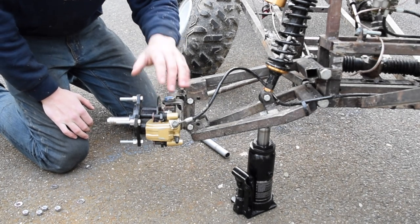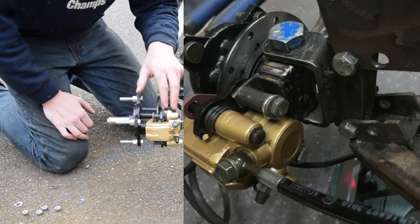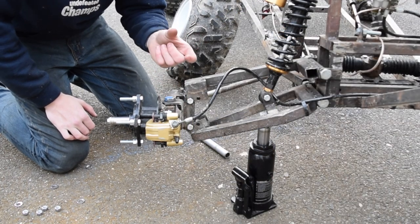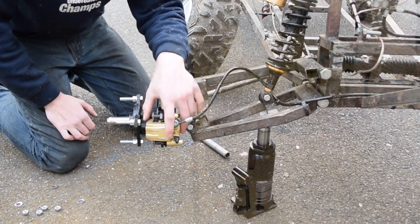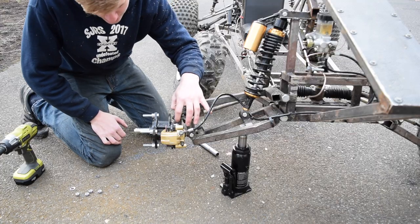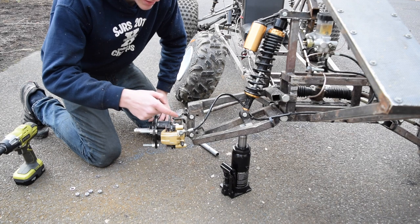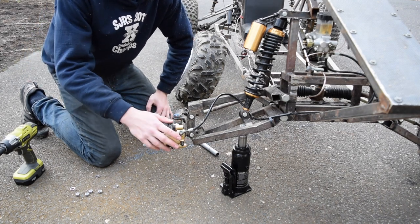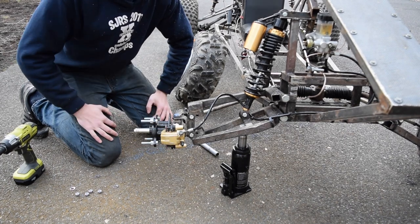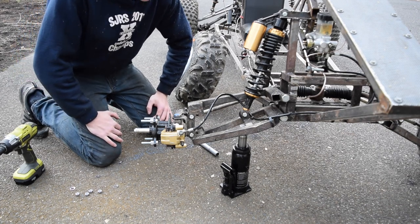As far as mounting the caliper, that's mounted using 5/16 inch bolts going through quarter inch angle iron. I cut the angle iron into a U-shaped bracket to fit the caliper, drilled holes in it, and then welded two quarter inch thick steel plates to the spindle itself and then welded the angle iron on top of that to space it out properly. This happens to fit perfectly inside my 8 inch rims for the front wheels — some people have had issues with that but I was lucky enough to get away with it.